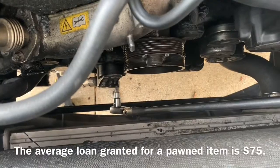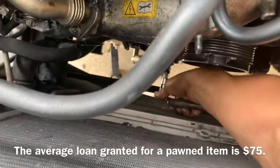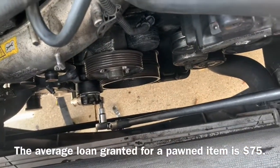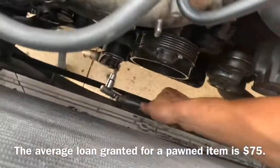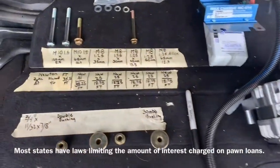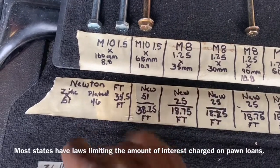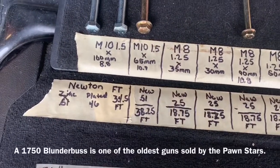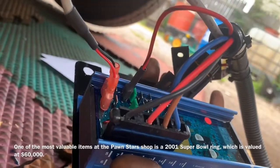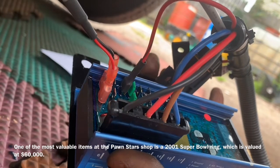At this point we're going to grab a T55 and insert it into the tensioner assembly hole and move it up and down three times to set the shock on the tensioner. If we do not do this we may have premature belt failure. Now we're going to grab our 100 millimeter 10 millimeter bolts, lock washers, and washers and install our alternator. We're going to tighten these bolts down to 35 foot-pounds. I'm going to disconnect my voltage regulator from my alternator so it is not dangling around.